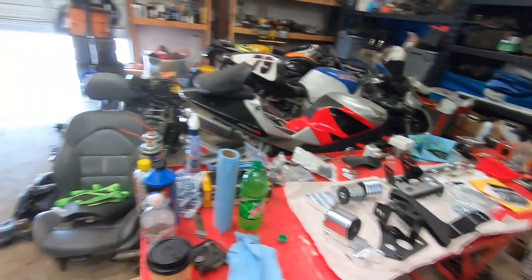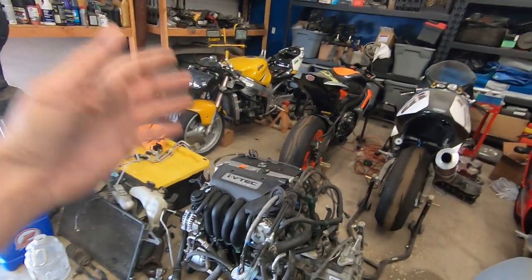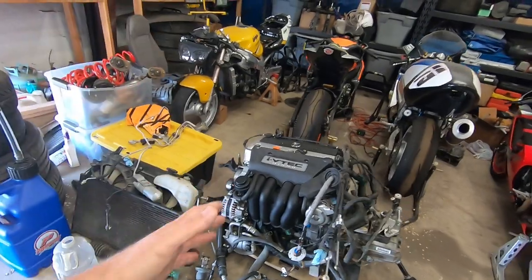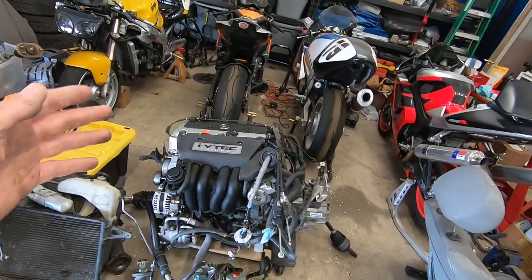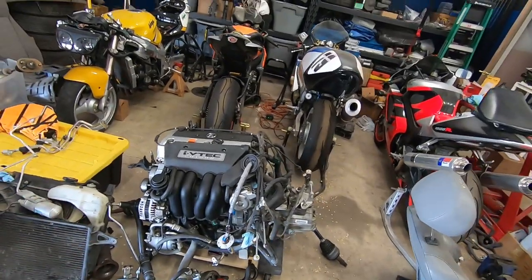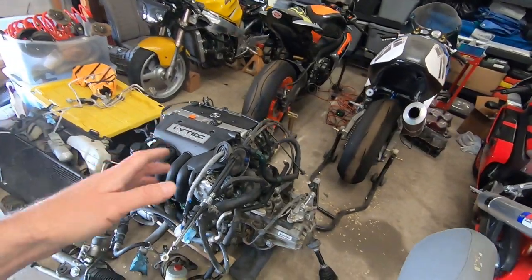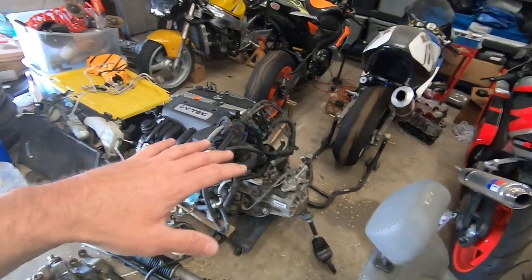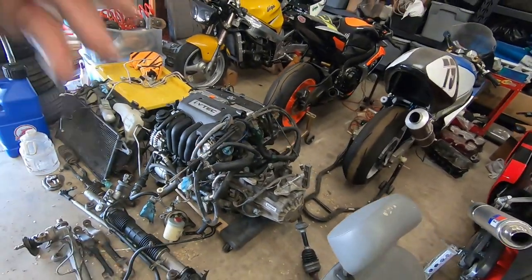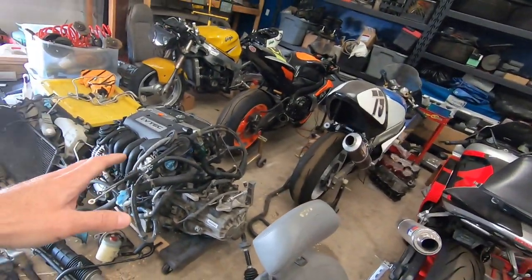Now that we've gone over what I have, I want to do a compression test on this engine to determine its health. The guy was pretty straightforward when I got it — he said the engine has about 140k on it, but he drove it after the rear-end and it was still drivable, still had plenty of power, ran great, no check engine lights, and did not smoke. I still want to determine the health of the engine with a compression test, and I'm going to put it on a stand and take everything off — the transmission and so on — just to go through the seals and clutch condition, because I don't want to put it in the car and have things fail prematurely.